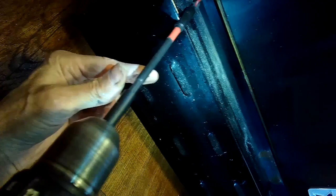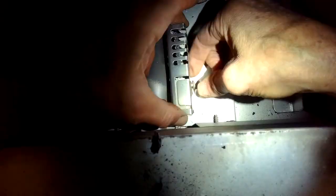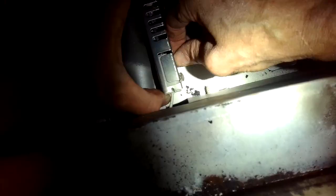Zip in these two screws. Then we have to attach the igniter to the burner tube — pretty easy. I'm going to line it up and by hand start the two Phillips head screws. To finish tightening them you can use a small screwdriver, or what I'm doing here — using a DeWalt angle tool with an extension, which makes it super fast and easy. I got my DeWalt angle tool at Home Depot; I think they're about 30 bucks and it's really rugged, has lasted me many years.